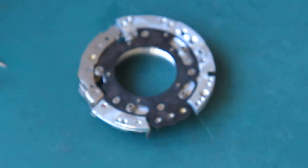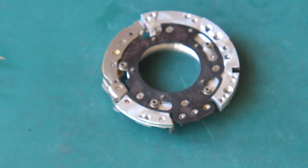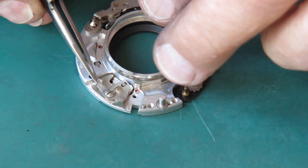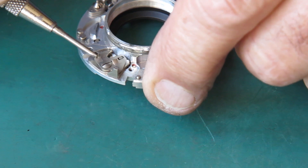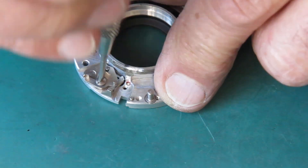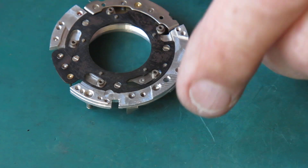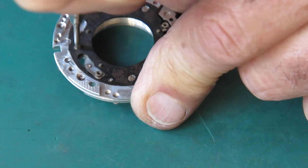The mechanism plate needs to be stripped down. Let's have this apart. You can unhook the spring — this is the little tab that actuates the blade actuating ring. It's a bit stiff, but certainly enough to affect the operation of the shutter. We'll take that arm off, and underneath, the retaining plate is held in place with four screws.